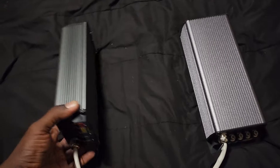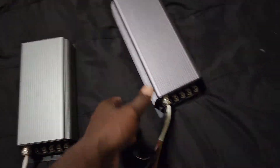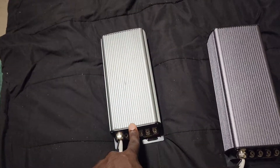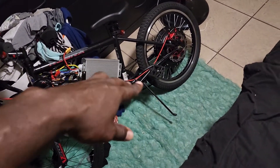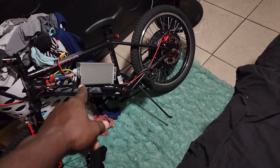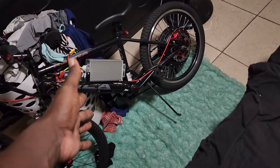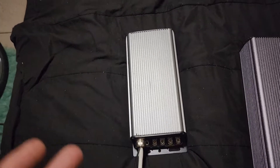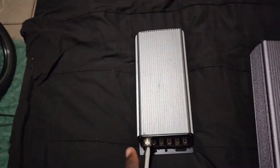Back to these controllers — you're not gonna go wrong with either of them. Honestly, the 150 is a little bit overkill. The 80-amp controller is really plenty for a 3,000-watt motor. With the 80-amp controller and a 52-volt battery, I was getting up to about 47 miles an hour. With this bigger controller I got a straight 50, but you need the right battery to match it.